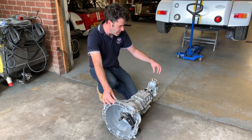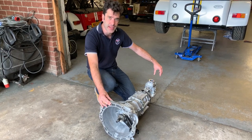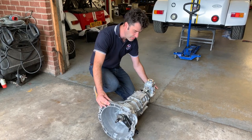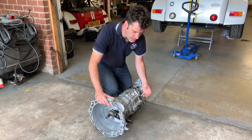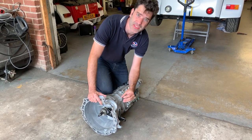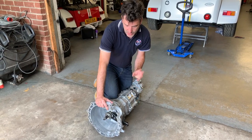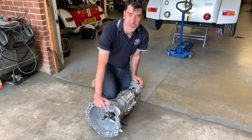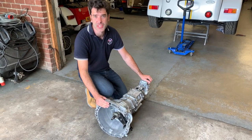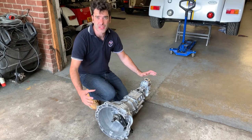We run this as it is. We do a nice little quick shift and an extended one that moves it back if you need it, or you can go straight on. We've got all the prop shafts and gearbox mounts sorted. We've done all the clutch slave cylinders — quite a nice billet aluminium one with different bore sizes, so depending on what type of clutch you've got and what force you need, we can alter the diameter to alter your force. This is a direct fit to the Duratec, so it will bolt straight on — no adapters or anything needed — it's an OE fit.